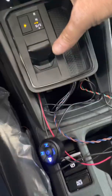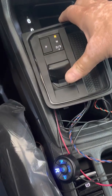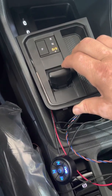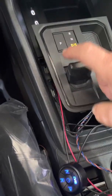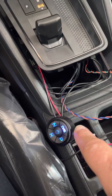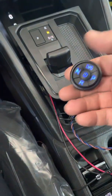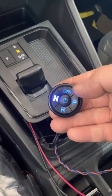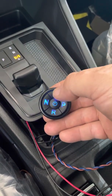The factory switch still works — you can still shift from the factory switch. For example, I can shift to neutral, press and hold for reverse. You have to press fully, and you can see the drive indication. Press again to go to sport mode — it blinks, meaning you are in sport position. We can continue shifting after using the factory switch: shift to neutral, shortly press for sport mode, shortly press for drive mode, and we can see sport and drive indicated.